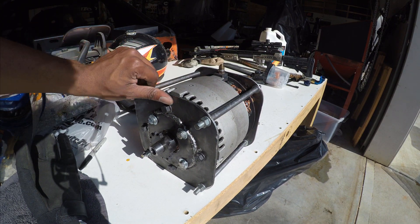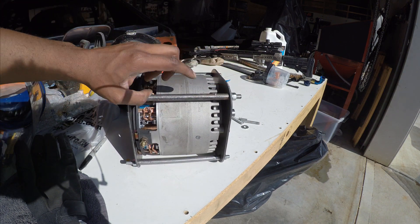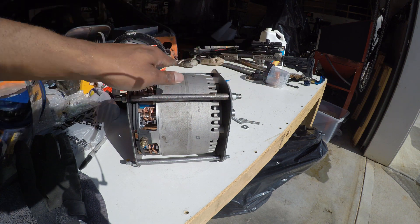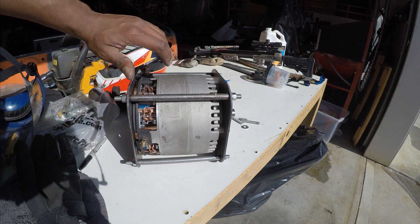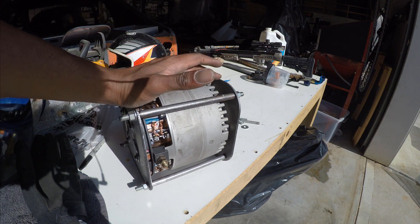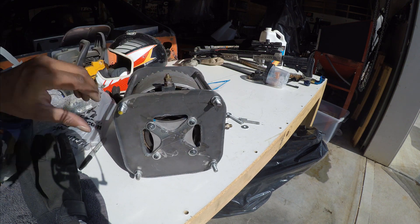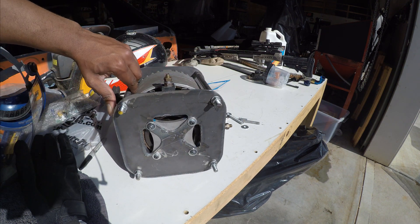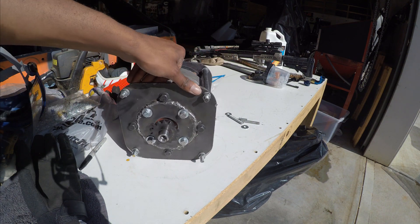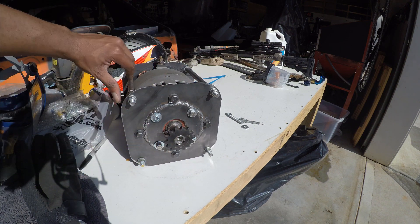Here's the motor and its casing — the motor housing. You saw how I was able to bolt these little tubing pieces over threaded bolts here. This is what I'm going to use to extend the plates out to mount the motor to the motorcycle frame and also make the mounts for the batteries. It turned out really well. The casing is very strong and is going to be a stressed member in the frame. I'm going to paint it all black and there's good clearance here for my chain.